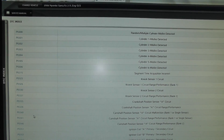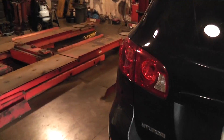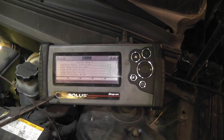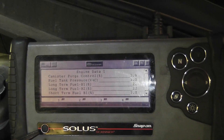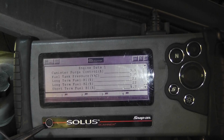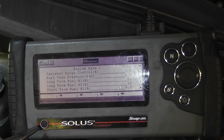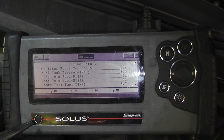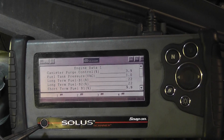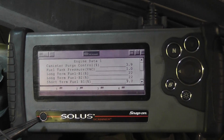Sometimes when you see lean at idle or stuck lean and a rich code, I've seen oxygen sensors stick. But when I saw bank two also system lean, I figured just check my scan data. When I saw both banks lean, this has to do with the canister purge. I ran the emission test and while waiting to get my rack open, I pulled it up on IATN and sure enough it showed up under Kia and Hyundai - the system leans, not the system rich, had to do with the purge valve sticking open.